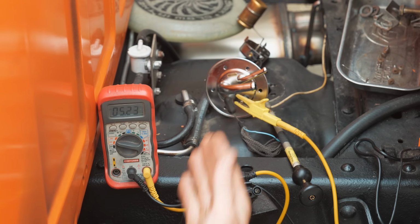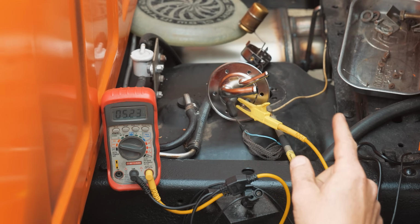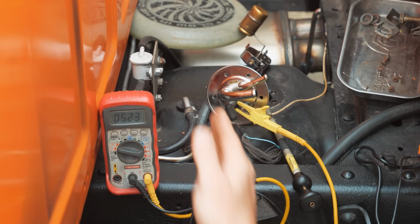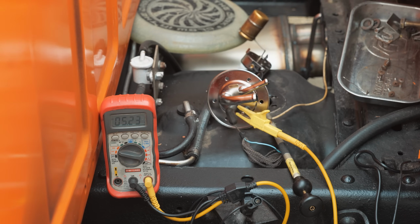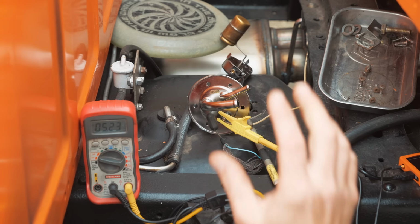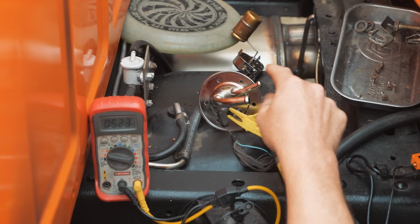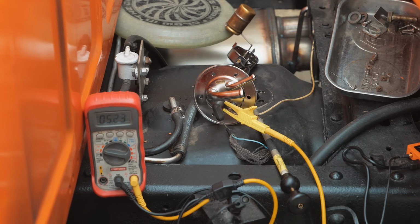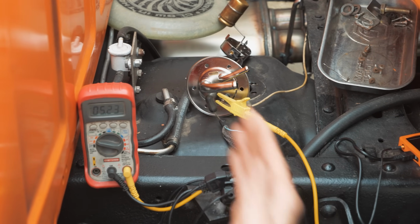If you read 5 on the signal and 5 on the ground, you have a ground problem. Don't drop the tank. If you read 5 on the signal and 0 on the ground, you're dropping the tank. Make sure when you go inside that the ground pin isn't messed up inside. There are some measurements you can do externally to check that internal ground, but either way, you're going inside to fix it. Tank's gotta come down or the bed's gotta be moved if you see 5 and 0.